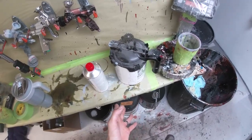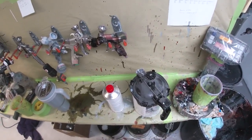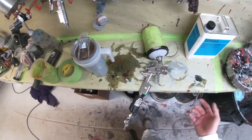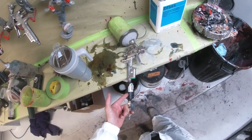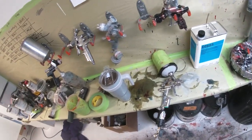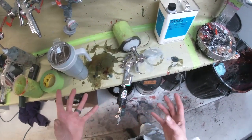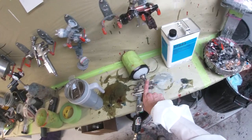This color calls for a value shade 5, so we're using DAS sealers — mixing shade 5 straight out of the DAS 3025, DCX 3030 activator, and 885 reducer. For spraying sealer, I'll be using the SATA 3000 — I usually use this for sealer and most base coats. It's got a fisheye filter; I always want one on there. We have an air dryer off the compressor, and inside the booth we've got another air dryer and two three-stage filters — one Sharp system and one Tsunami system. I really like this fisheye filter: it flows way more than a normal bulb filter, has replaceable cartridges, and if contaminants get in it, it stops airflow instead of shooting them into your paint job.